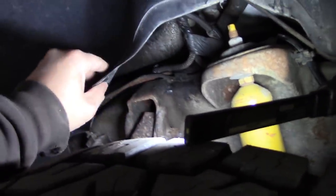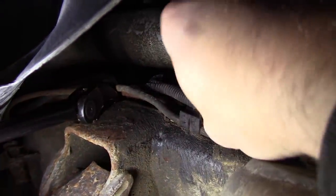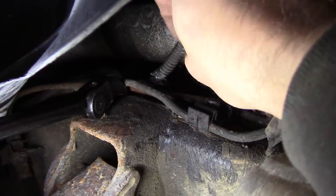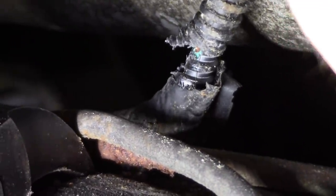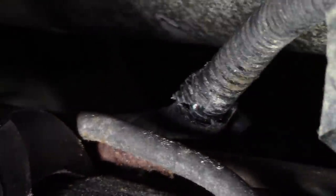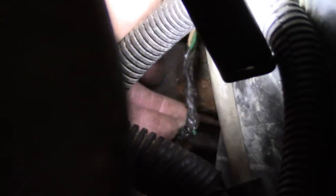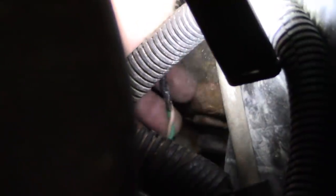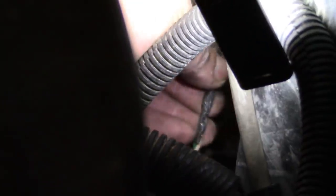There are no connectors in that wiring harness — it runs continuously from the connector at the shock tower, along the frame rail, underneath the radiator, back up the frame rail, right across where the left side wheel speed sensor is, and all the way back to the ABS module. There's nowhere to split the harness. Doing a visual inspection, I think I found the problem — right there under the fender liner. Looks like a dark green wire, and maybe we can get to that easier from the top. There's the money shot — dark green wire, hacked right in two. Looks like somebody's fixed this before; I don't think that's a factory tape job.